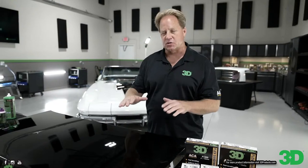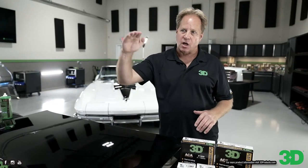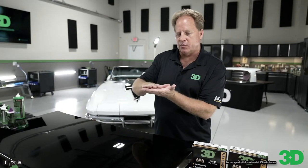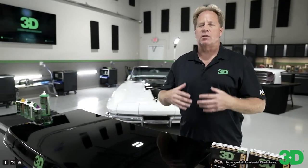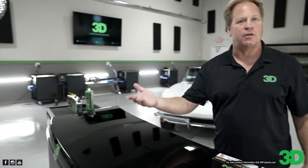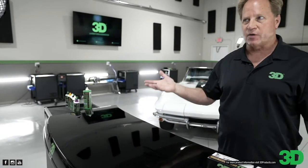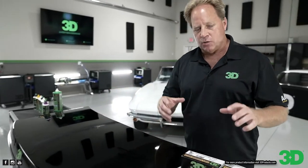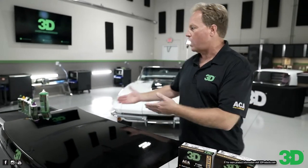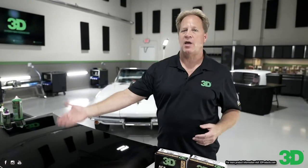The goal when you're sanding to remove orange peel or any surface texture is to knock the tops off and stop when you get the highest portions removed, so you just leave the lowest portions. That reaches the goal of flattening out the paint while leaving more paint on the car. And that's the part everybody forgets to explain. The whole reason you use a well thought out system is to accomplish the goal: create beauty while leaving more paint on the car.